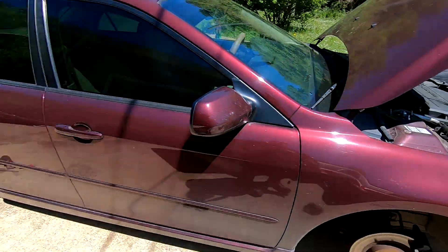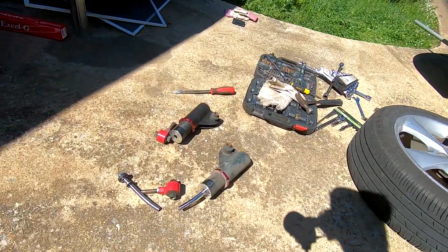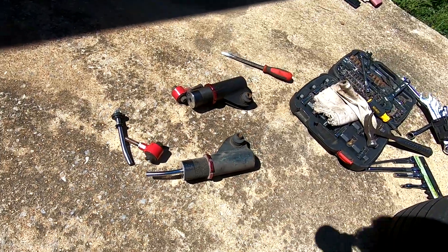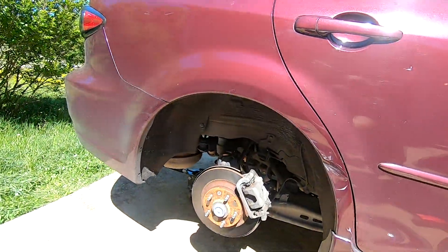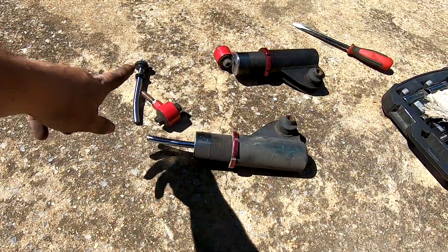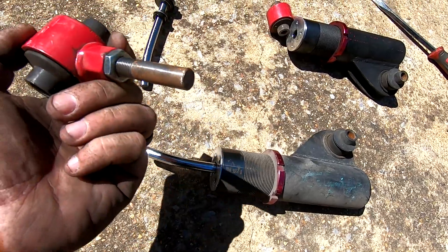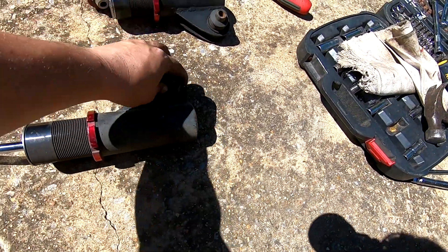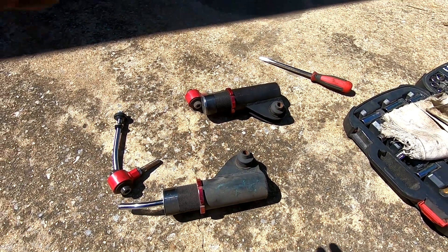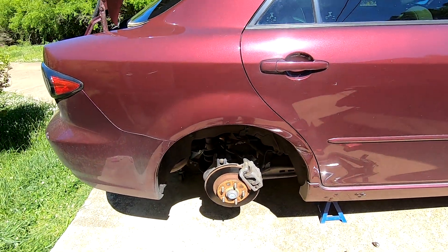That's all in the front really. Moving on to the back where I've had the most issues - I'm actually fixing what's been giving me the most issues, which is the shock absorbers that come with the eBay kit. The Mazda 6 has a coil spring and a shock absorber on the rear, so it's not a true coilover. Well, these have both bent and broken, and the bushings won't stay in them - they keep walking out. That's actually what I'm here to fix today.